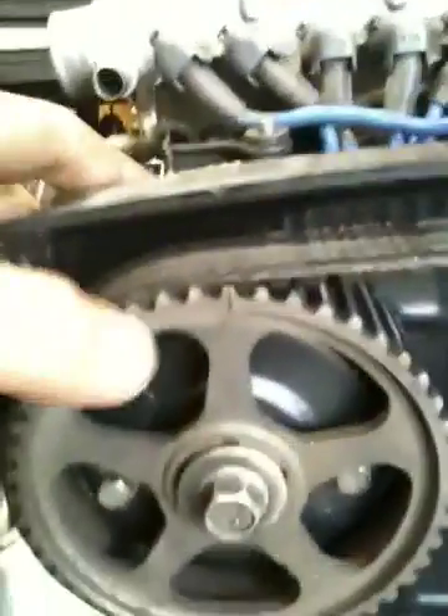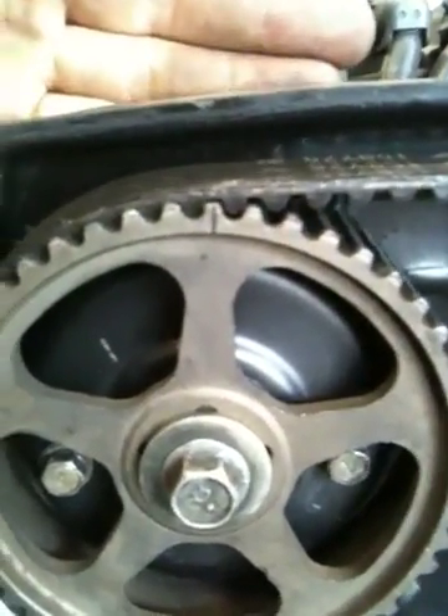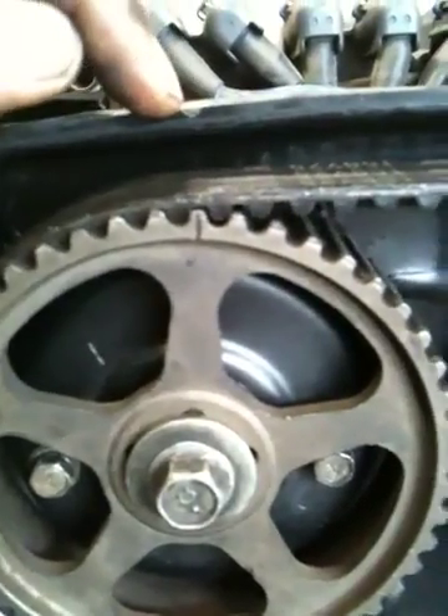You want to go ahead and get zero on the crank. See my front timing mark right here, and also in the back here — that's at zero. You also want to make sure that your gear is on the top, both sides, and you basically want to match that up with the notches in the back plate on both sides.